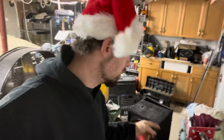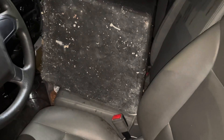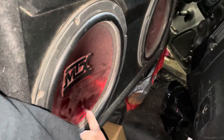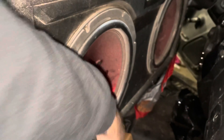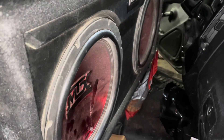I'm going to start installing this. I have a regular cab truck so you'll see how tight it is — the sub is going to take the place of the armrest and the amp will go on the floor. It's not really the ideal install but it's only temporary — I just want to put this in and show the guys what I used to have and the fun that came along with it. These subs are going to be my armrests. Connected up at 2 ohms, that amp is fully 2-ohm compatible up to about 1500 watts RMS. We're going to clean these off — that's how much dust is on these things. I'm going to rock these for a couple of days, jingle some bells — it's Christmas time.